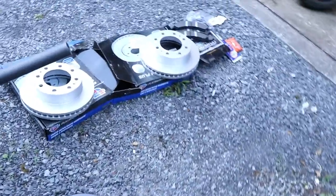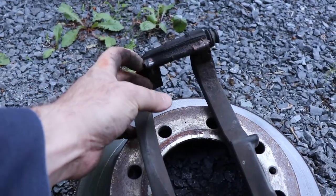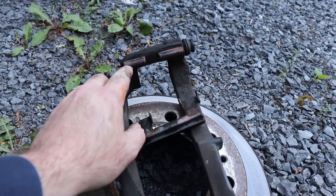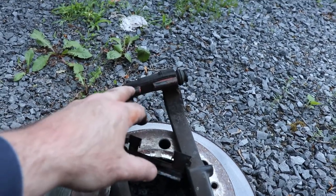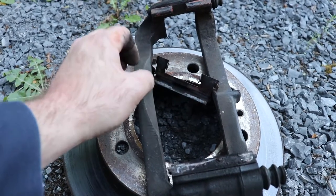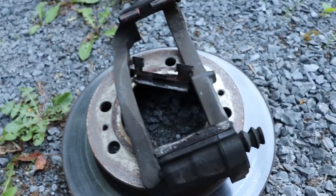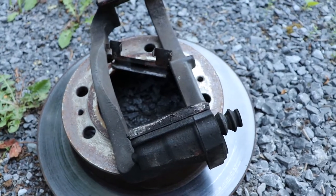The squeaking part of the pad faces forward. These pads came off and on this side they are in quite good shape — just not going to do it for me though. I'll have to take off the adapter and rotor, clean everything off, and replace the rotor which is good to go. The rotor looks nice — it hasn't got a ton of miles on it since the brake job was done, but it shakes now, so no good.